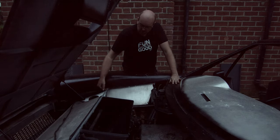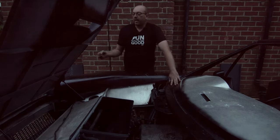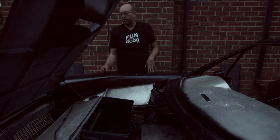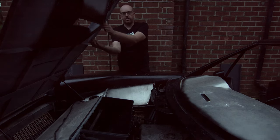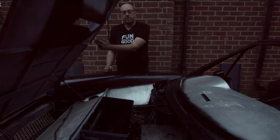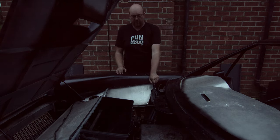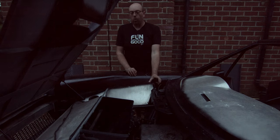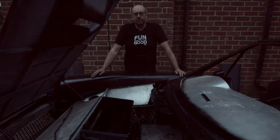With the front edge of the bonnet sitting probably 10 mm too high compared to where we designed it, it is still not enough to give a small enough amount of deflection that keeps the positive engagement on the latch and stops this from cracking, which is really, really frustrating. So we're going to have to look at removing this section of box that goes across the car edge to edge. If we really do need to put something in again, we can go down lower — we think it's completely redundant anyway. Then we're going to put a flat brace all the way along the edge, put some holes in the side so that we can weld through and get good engagement across there without having to weld a big long seam down the inside of the bonnet edge. That will hold it at the right angle permanently with just the tiniest amount of flex left to give us some engagement, and if we get it spot on, we can probably lower these hinges by maybe one turn so we can close the bonnet without cracking the paint.